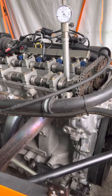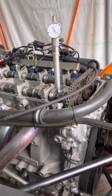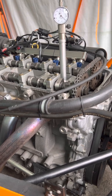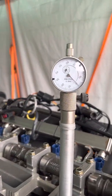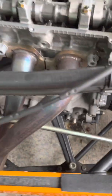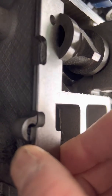So what we've done today is lock off the crankshaft. We've got a DTI confirming the piston is actually at TDC, because we never go by the factory lockout tools — they can be as much as 10 degrees out and that's just not good enough. The gauge is at zero, the factory lockout tool is in. So we go back to the camshafts and have a look. The intake is nice — that goes in beautifully.